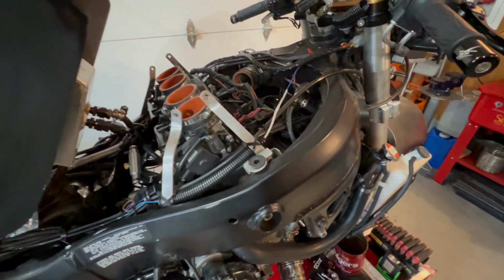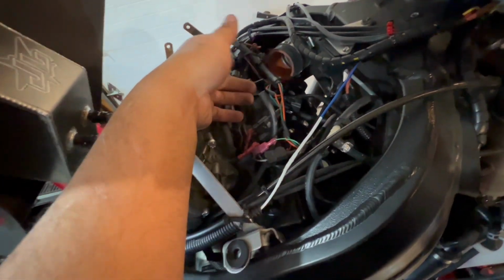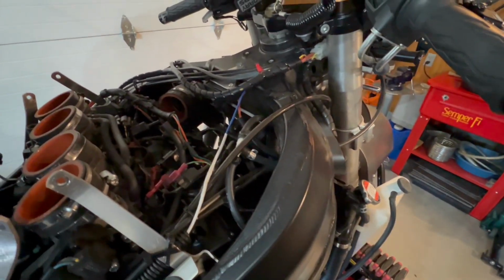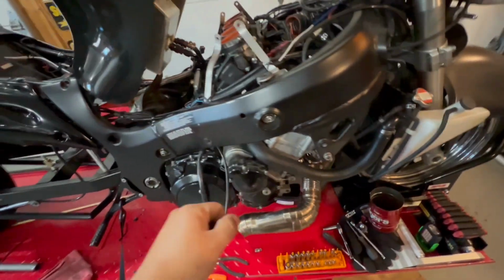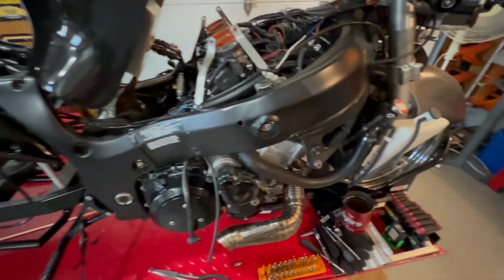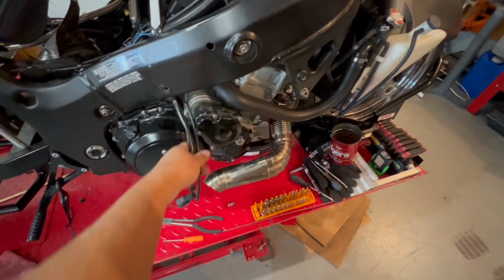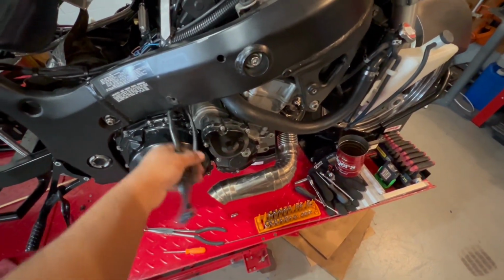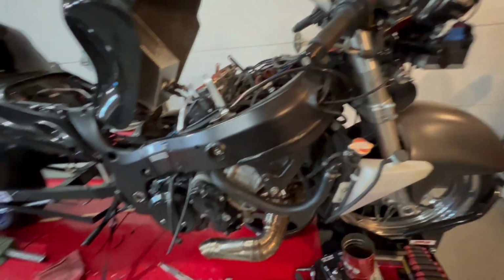Part of the, I believe that is the launch master, is this harness here, which goes to the coils, that activates our two-step. And yeah, just give everything a once over, make sure it's disconnected. That way I don't have to test the tensile strength of a connector that is still plugged in whenever this thing comes out. So yeah, we did get the oil pressure disconnected. So yeah, we've made some pretty good headway. Just gotta finalize it and get it out.